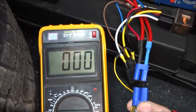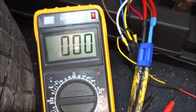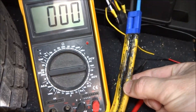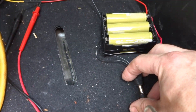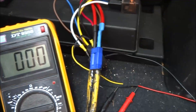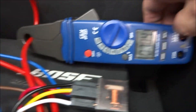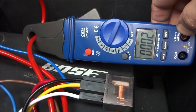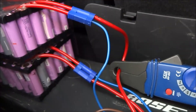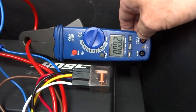I'm going to connect it here. This is not active right now — the car is on, but the relays are not active until I connect this. And there we go. So right now the two packs are paralleled, and I have roughly 0.2 amp draw, because this pack is slightly higher voltage, but not much as you can see. If I leave it on, it'll stabilize.